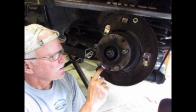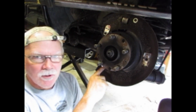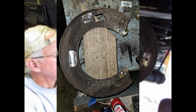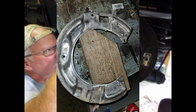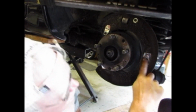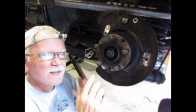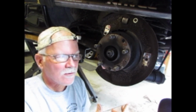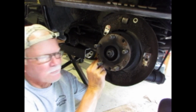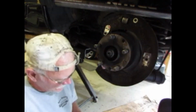First thing first, the backing plates. Yours might be rotten like mine were. I made some little aluminum filler pieces, pop riveted them in, and bolted them on with washers. This one, I had one good hole, but the other three were rough and broken through. This thing had tie wraps on it holding it together, so it's aluminum. Cleaned it up. That worked fine. Just molded a couple pieces of aluminum. This is nice and secure.